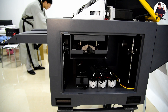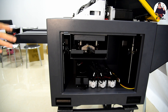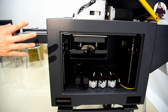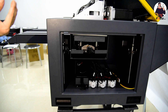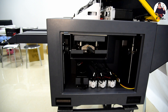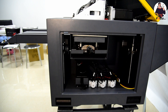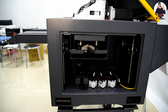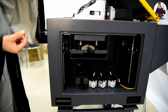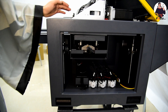Do a normal cleaning for all heads to wipe the ink. This is the cleaning procedure: first the pump works to pump the waste ink, then it pumps waste ink again before pumping ink, then pump down and up with the wiper ink. Then going down for flushing. Now we go to check if the ink is coming out or not.